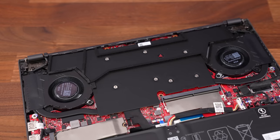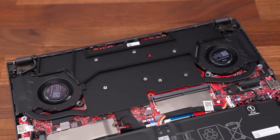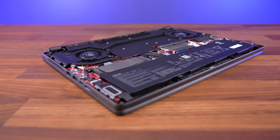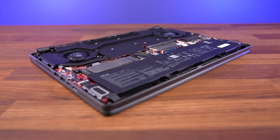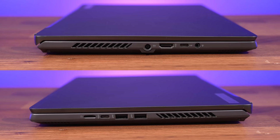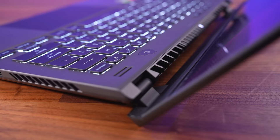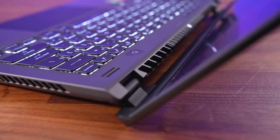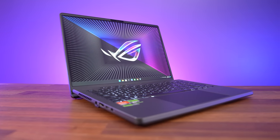It's got a vapor chamber cooler covering the CPU and GPU, with Thermal Grizzly liquid metal on the CPU but not the GPU, which has paste. Last year's model had liquid metal on both, but it also had AMD graphics - perhaps an Nvidia GPU has less to gain. There are holes directly above the air intake fans with dust filters. Air gets exhausted out the left and right sides and out the back, and despite angled vents the lift-up design results in hot air blowing against the screen. They've had this design since 2020 without widespread problems though.